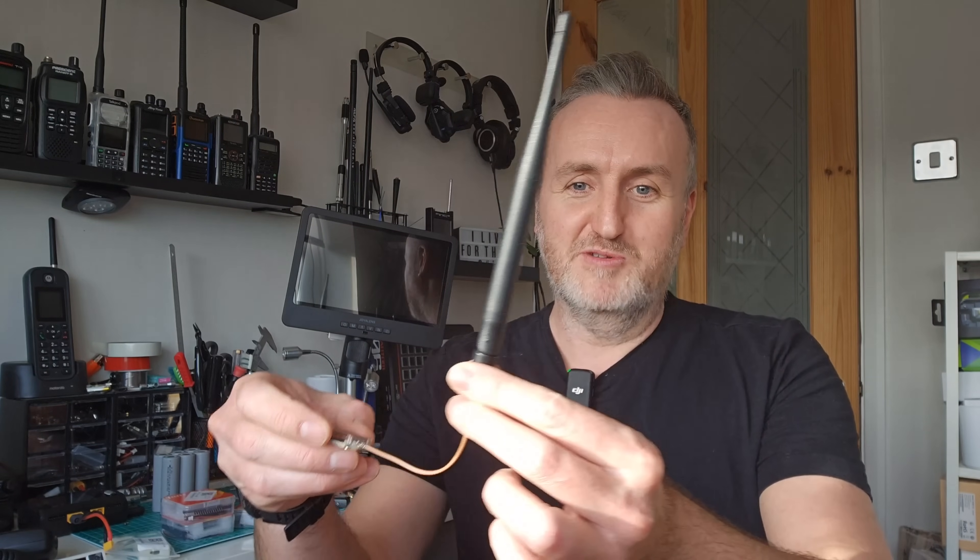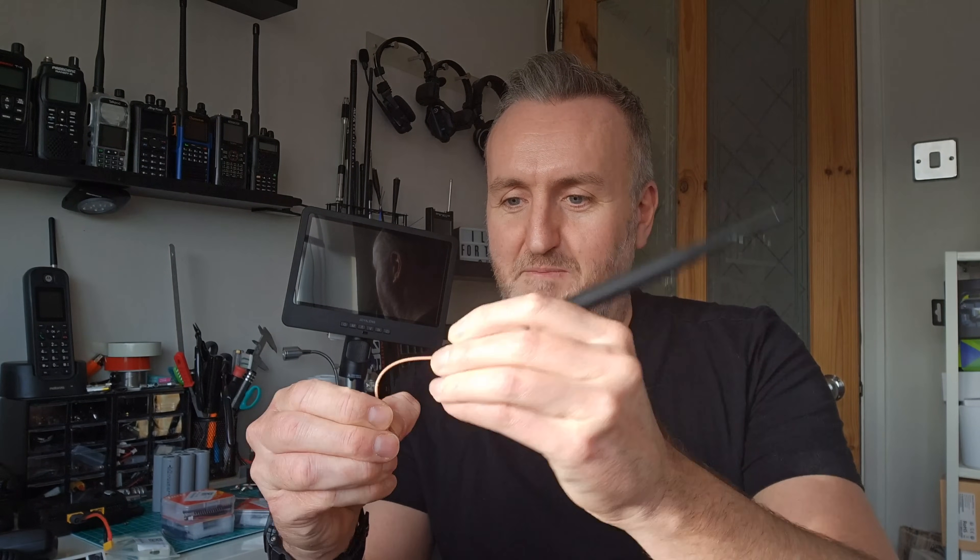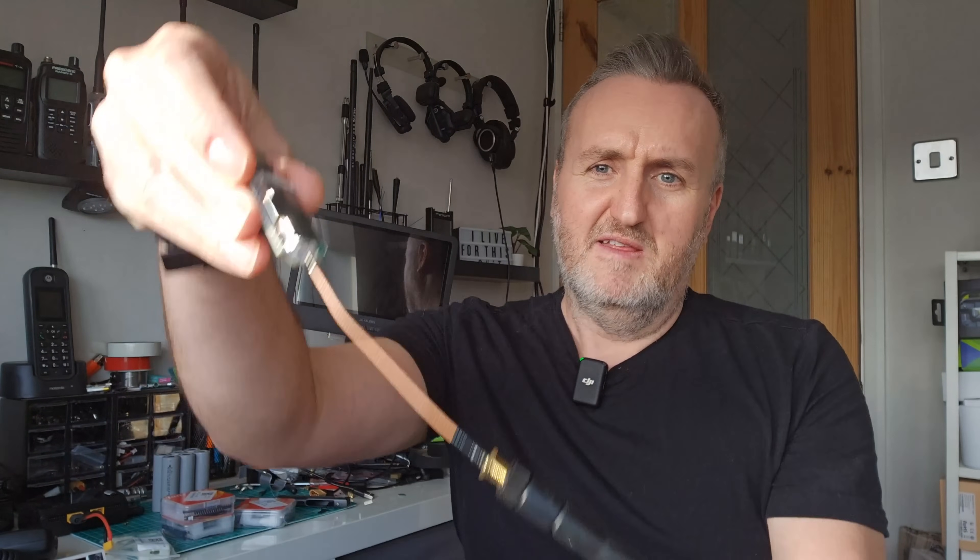It's not portable or anything like that — you're going to have to maybe put this in the loft or something. But the point is it will work really well and give you a much better experience. If you strung that up in the loft with a USB power supply into the bottom of it, it would work really well. Just make sure it's not obstructed — don't tape it across a beam, try and have that bit in free air. It's going to be miles better than the ones that come in some of these other boxes.